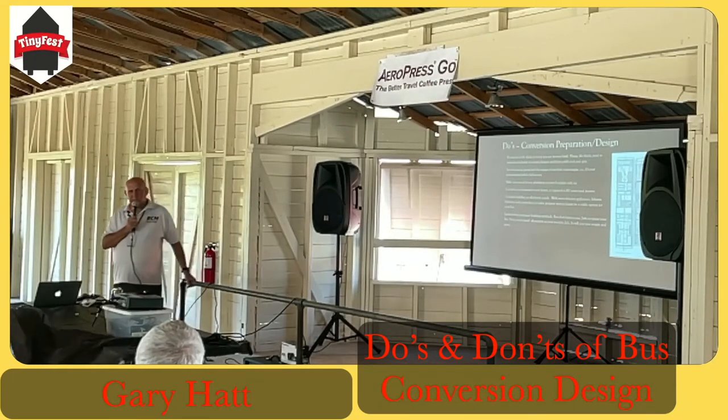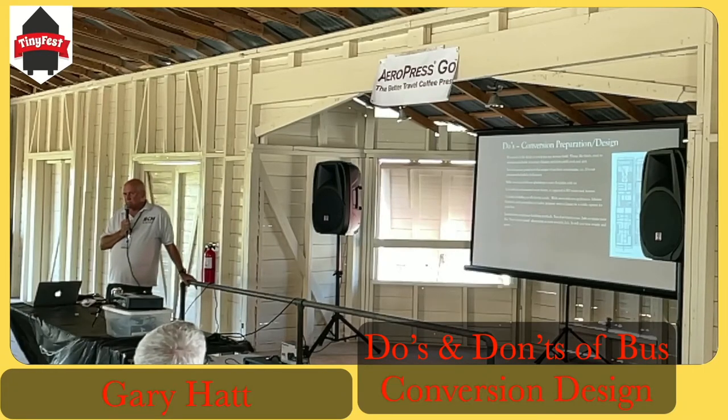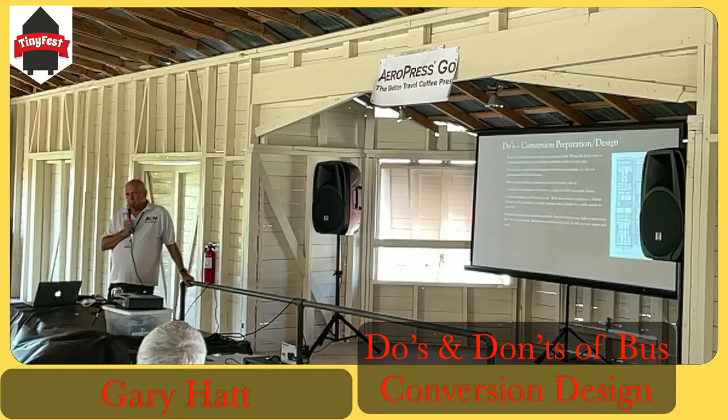The first bullet says, be careful of what kind of wood you use in your bus. Like birch will be a problem if it's in a dry climate. It can expand and contract and crack and all that stuff. It says you don't need 2x4s. I see a lot of people building schoolies out of 2x4s. 2x2s are plenty rugged enough. And my bus, in fact, none of my buses have ever had a 2x2 or 2x4 on it.